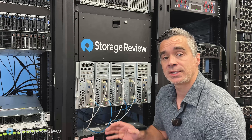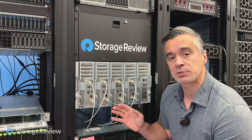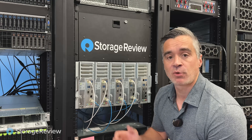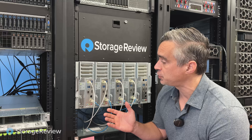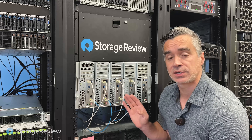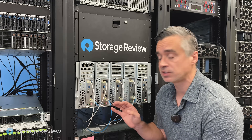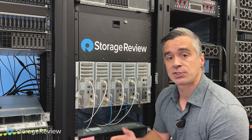The affordability is a big selling point of these systems, and while some of the components feel sort of consumer-y like the ATX boards, inside you'll find things like AMD EPYC 4004 CPU support. You can run Ryzen as well, there's room for GPUs, and it's got dual power supplies for each one. Each one of these servers is independent — there's no shared backplane, no shared power supplies, so each one can be siloed off and managed independently.